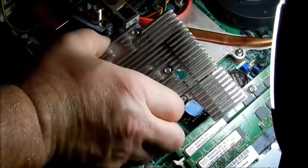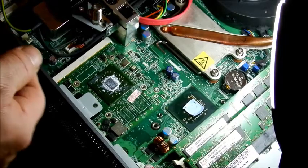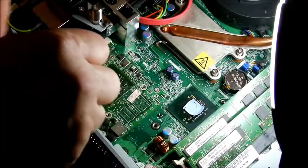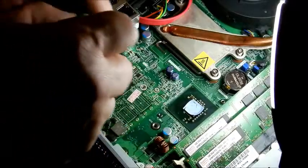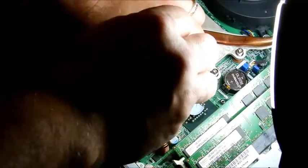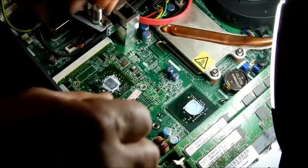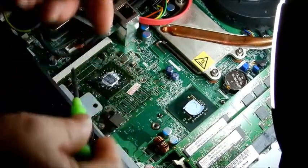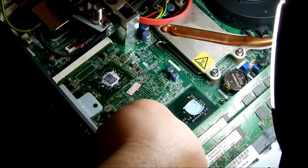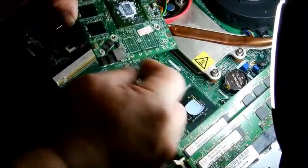Click on there and pull it out that way. There is some liquid on the bottom — just leave that on because that stuff doesn't dry. There are two screws: one right here and one right there. We don't want to touch the circuit board in the wrong places, so be careful. If you're not grounded just touch the frame and you'll be grounded. I'm going to put these silver screws in the middle of the black screws over here to keep them separate. It lifted up — going that way — there's the chip. Grab the sides and top of the chip and wiggle it back and forth to pull it out.